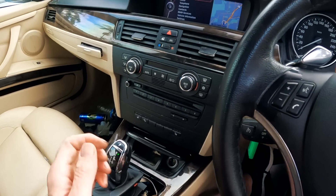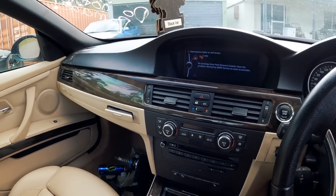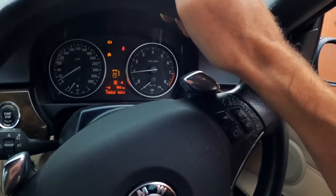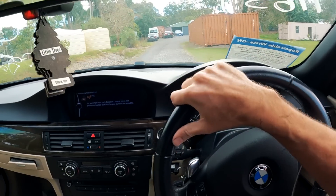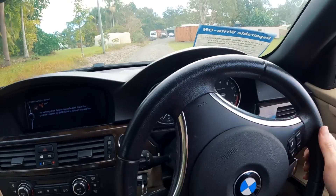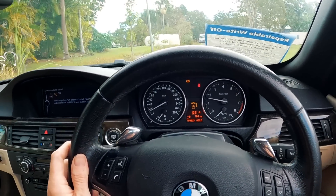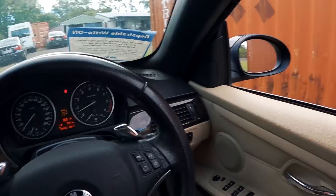What I want to do is see if this gearbox works okay, so I might just take it up for a drive and see how the transmission is. This is kind of sketchy with no power steering. Reverse seems to work. The adaptive headlights aren't working — what a shame. There's a bit of an alignment issue. The car doesn't go in a straight line — very hard to reverse. Put the transmission into drive and we'll just make sure it goes through the gears. It pulls away fine, shifts nicely. ABS doesn't work, but it looks like we've got a good transmission.